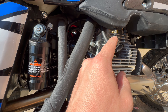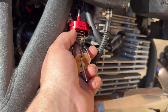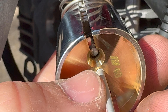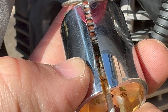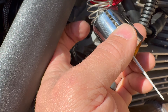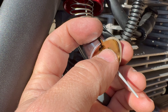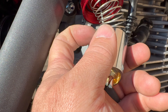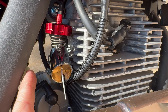Time to take this apart and put the new one together. These are all new parts that came with the carburetor, just swapping over our factory throttle cable. To get it out, you see right there — that's what's holding your throttle cable in. Then that little black sleeve is what's holding your spring. You pull your spring up, pull that little black thing out, slip your cable through, pop it down at the bottom, get that out, and swap it over to your new carb.